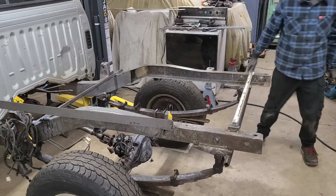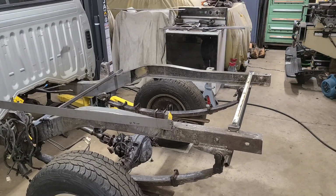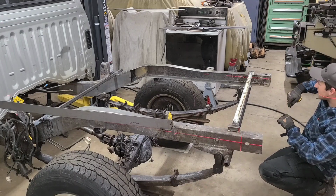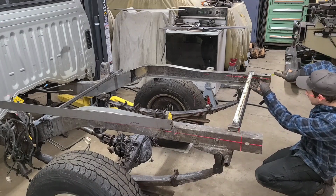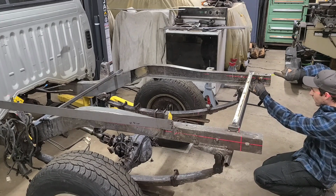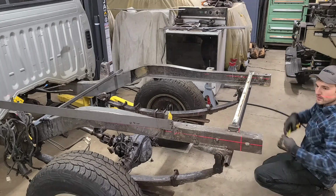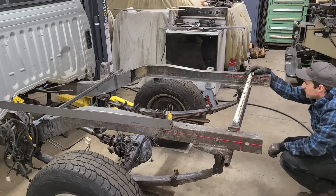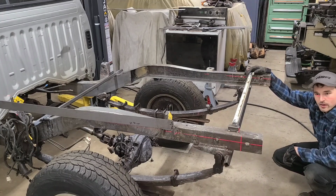Okay. I'm gonna turn my laser back on. Get it centered on the hole, right about there, centered on this side. Come over here, I already see it's a lot better. It's not bad at all now. I'm measuring from center. We're off maybe an eighth inch. Considering all the variables, that's far improved. I'm much happier with that.